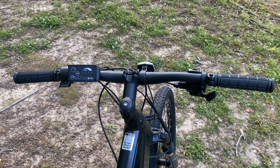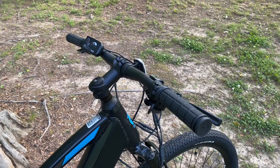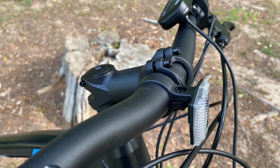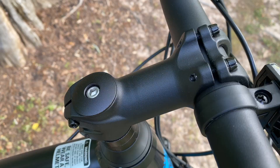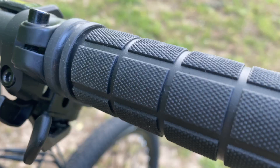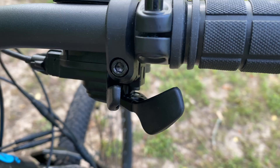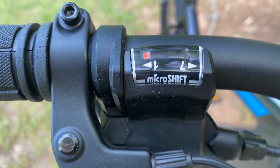For example, the bars are only 655 millimeters wide, but they are what Schwinn calls oversized, meaning 31.8 millimeter diameter. The threadless headset may look familiar — thankfully we're finally seeing threadless headsets on just about everything called a mountain bike at Walmart. Grips are standard slip-ons, and there's a trigger shifter with seven-speed shifting via the MicroShift shifter with an easy-to-read selection view window.